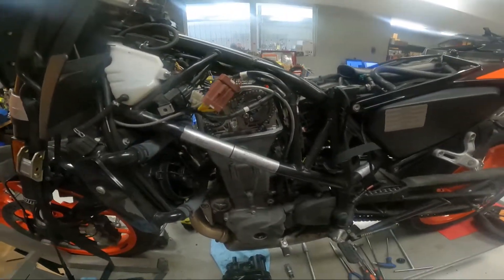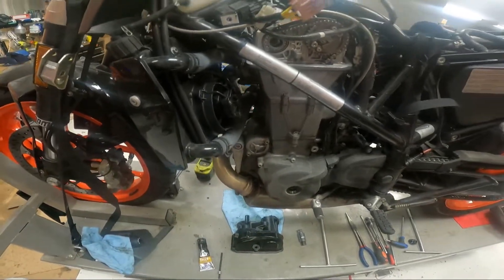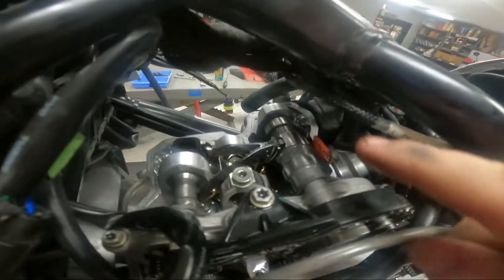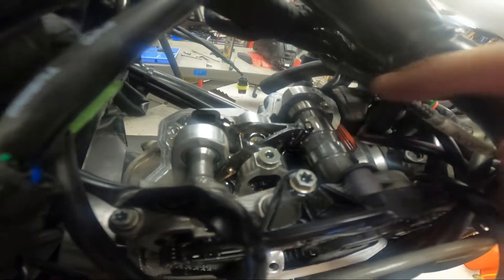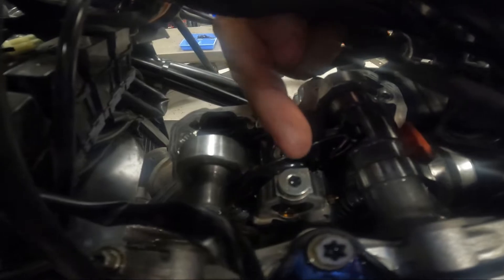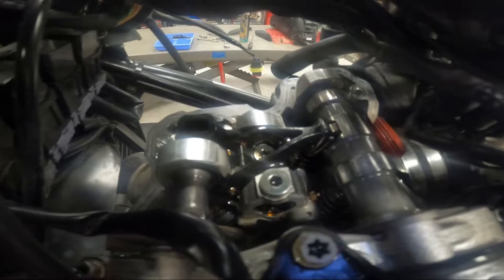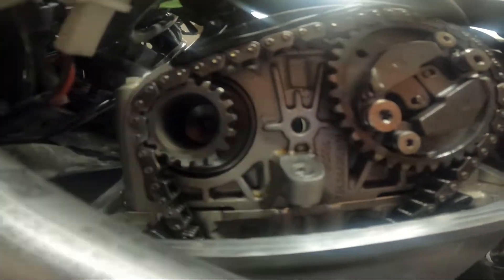With exhaust it's a little different. You want to take the tool back out, unlock the crank, rotate the crank a few times, and then rotate it until you see the decomp button — try to get it right above this rocker arm right here. Then you want to take out both bolts: the bolt going through the rocker arm and the bolt above the rocker arm. The bolt above is going to allow you to slide out the rocker arm shaft.